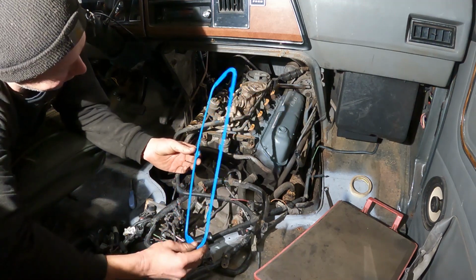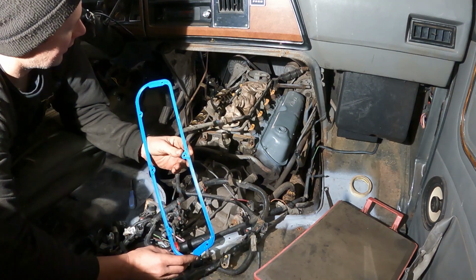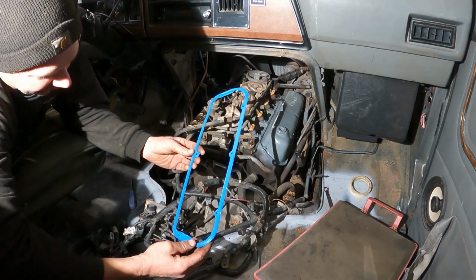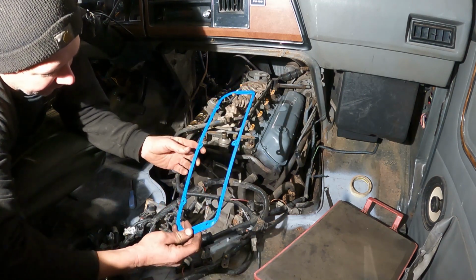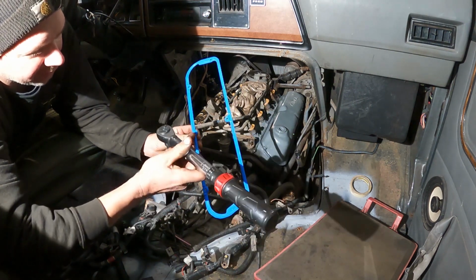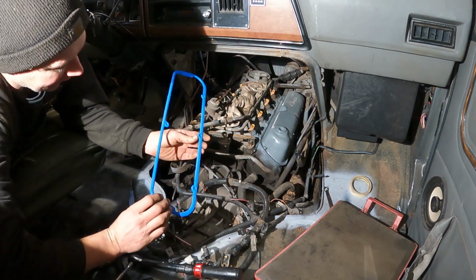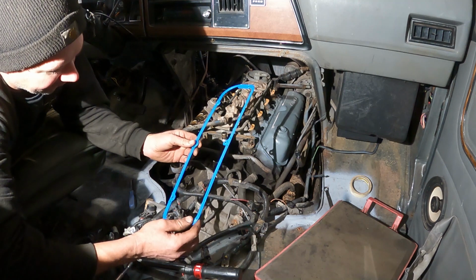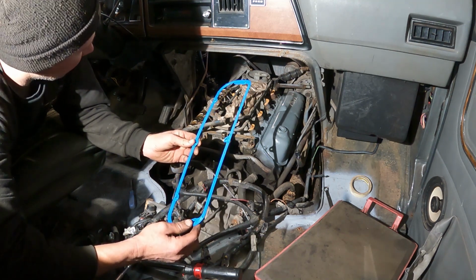So I'm using these really nice Felpro crush gaskets. These are like the latest technology in gasket stuff instead of like cork and stuff like that. They're steel and rubber pushed together, and they torque down to 60 inch-pounds. So if you get yourself an inch-pound torque wrench, that's 5 foot-pounds or 60 inch-pounds. But they're real nice. You can reuse them. They tend not to leak at all, and it's better than gluing on cork and RTV and stuff like that. So I've got a pair of these.